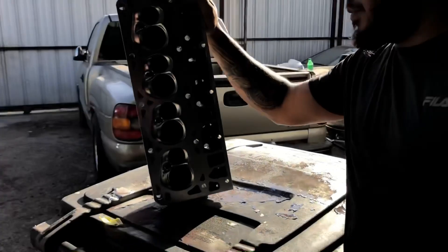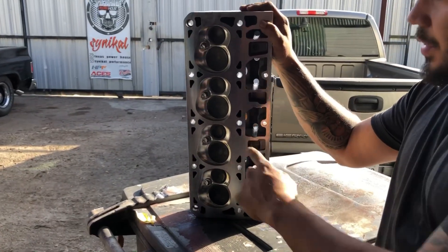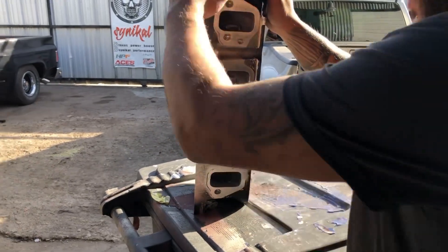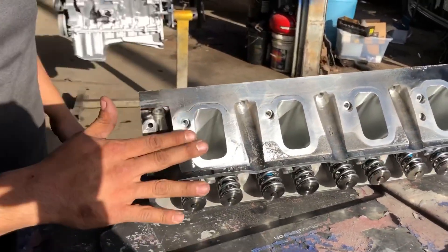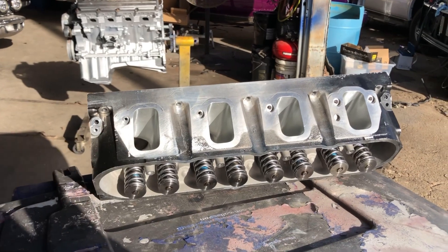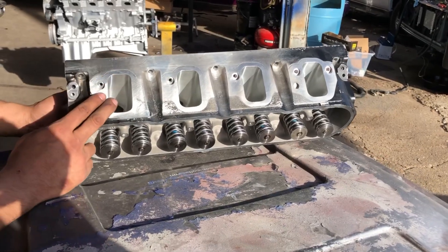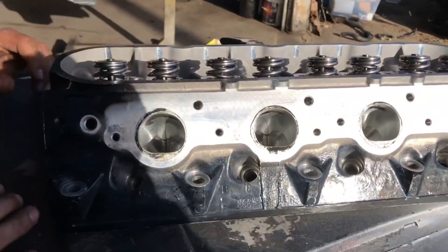Hooper will basically go through the whole process. He has a very nice setup specifically for LSA heads where he ports the chambers. You can see the combustion chamber has been worked — the bowls have been opened out. He also opens up the intake side. If you notice, the intake side from the LSA head compared to a stock LS3 head, this is way bigger. The nice thing about the LSA heads is since they have a little bit of extra material, you can cut them open a lot more and really get the power out of them. He works the intake side, does the combustion chambers, mills the head, and does the exhaust side. So it's a completely worked head.